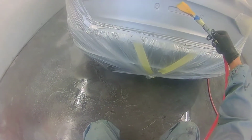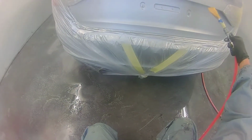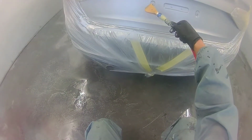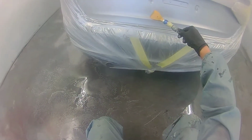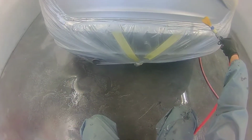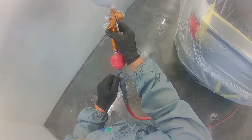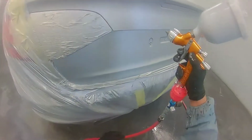I just took my time, had a quick think about it, and decided the less drastic action would be to just puff a little bit of base coat over the silicones to see how that went. First of all, it's definitely better than trying to sand from the off. Sanding base coat is certainly nothing I enjoy. There's just nothing good about it. So this was my first go-to.